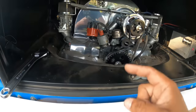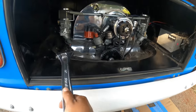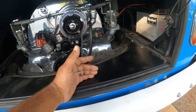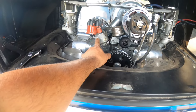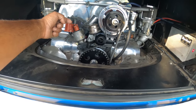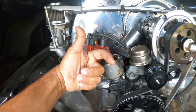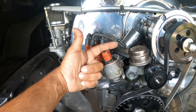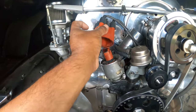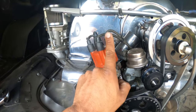So before you get started, make sure you take off your distributor cap, get yourself a big old crescent wrench, and find out where cylinder number one is. On your spark plug wire — on my engine, since when they built it, they kind of messed up on the timing, so mine's actually clocked one cylinder over. So cylinder one is actually pointing right at me. Traditionally cylinder number one is actually one cylinder to the right, so if you see your distributor cap on, traditionally this will be cylinder number one and this one will be two.